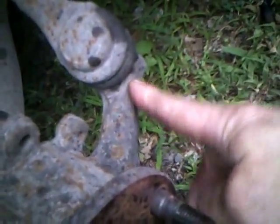Okay, I got all my nuts off. These are splined inside of here, so you can just whack them with the hammer, they'll come out of there. Might recommend putting the nut on there if you're worried about bunging up the bolts. Okay, those 2 are out. I also need to get this out down here. I'm going to whack it a couple times with the hammer. That should pop loose.